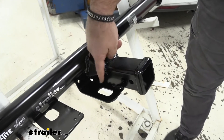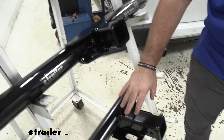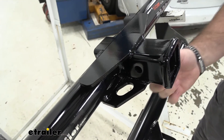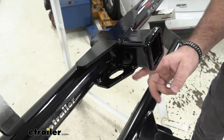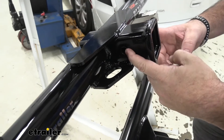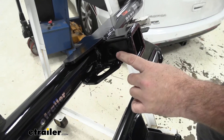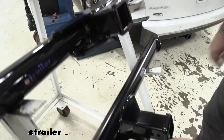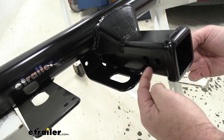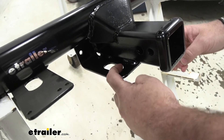Safety chain loops on the Draw-Tite — the plate sits a little bit farther back, with very large openings to accommodate very large safety chain hooks. With our Curt it is a plate style with very large openings, but you'll notice where the plate is located — it's right over a hitch pin hole. So if you put a locking pin inside there, because they're so thick, that can sometimes limit you on what size safety chain hooks you can get in. With the Draw-Tite you'll notice how far it sits back — the hitch pin hole is actually out in front so it's not going to interfere with our larger size safety chain hooks.